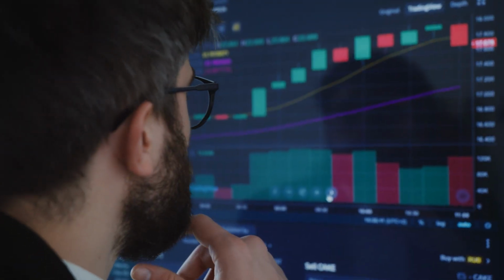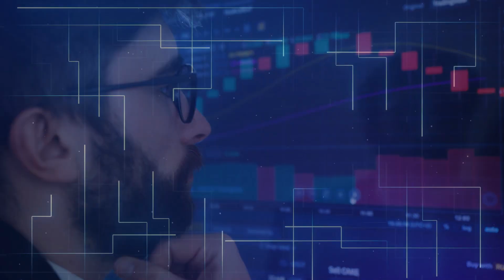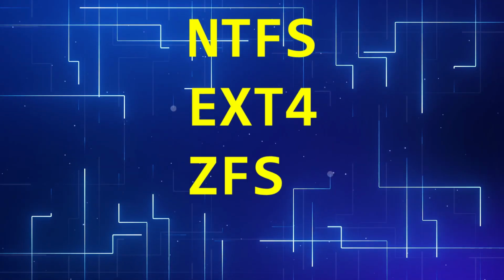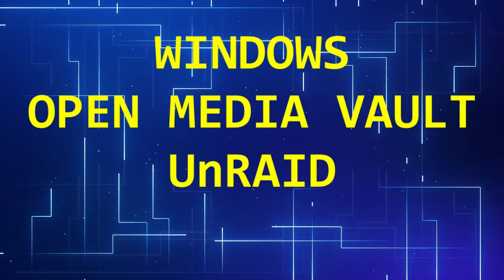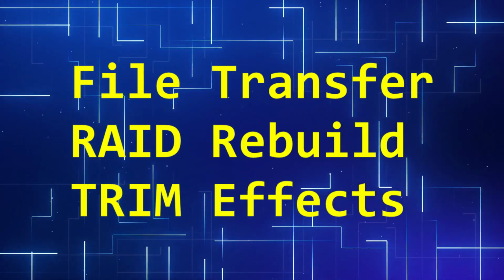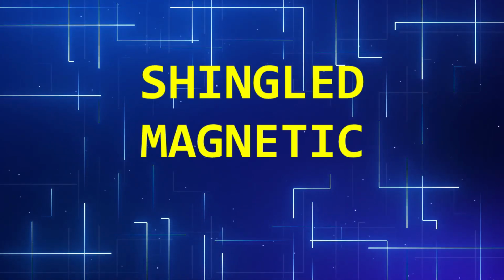It wasn't intended to be anything formal, just some basic benchmarking, but eventually it just ballooned into testing SMR drives across multiple file systems like NTFS, ext4, ZFS, and XFS stored in various RAID, pooled, and single disk configurations using Windows, Open Media Vault, UnRAID, and even SnapRAID. File transfer performance, RAID rebuild time, and trim effects were evaluated and documented with results that I'll show later in this video. If you aren't aware, SMR stands for Shingled Magnetic Recording.